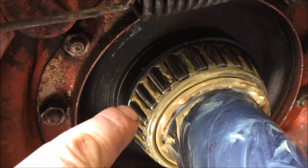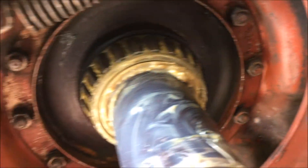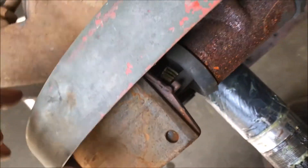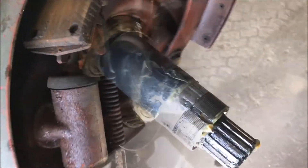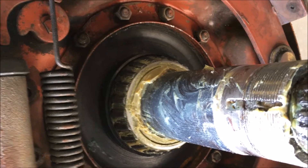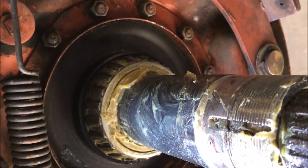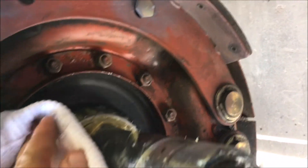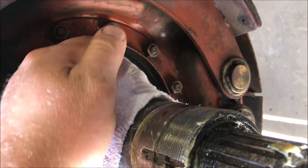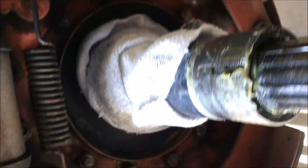You can see the inner bearing — it likes to stay on the spindle, and that's fine, just leave it there for now. Here's the ring of spindle nuts. We'll be pulling them off to get the backing plate with the brake shoes off, and the spindle will come with. Usually I leave that inner spindle bearing in place unless you're planning on repacking it or changing the back seal — there's no need to remove it. So just cover it with a rag, or if you're poor like me, cut up your sock and wrap it around there to keep dirt out of the bearing.